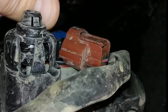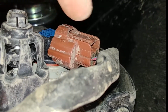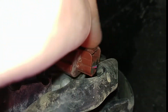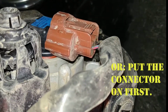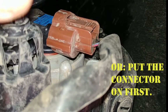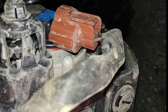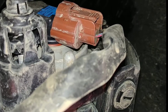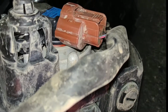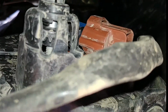It goes in basically 90 degrees to the ground, and then you twist it round this way, and then the plug comes straight in and clips. You can easily feel when the bulb has turned, because it basically is a dead stop. It's quite a smooth turn. It's only about a quarter, not even a quarter of a turn, probably an eighth of a turn, and pretty straightforward. So I'm going to test it before I close this back up, see what happens.